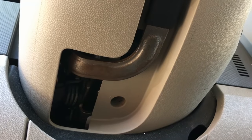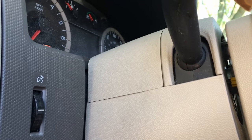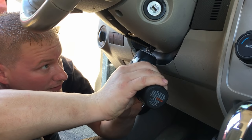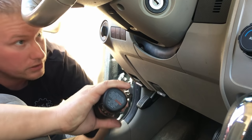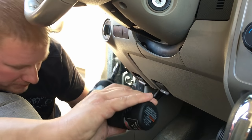Get your key out of the ignition. Underneath here you'll see some holes — there's a 5.5 millimeter screw there, and one right there. Take those three screws out and then we'll start separating the top part. They're small little screws, make sure you don't lose them — they are special little screws with 5.5 millimeter heads.